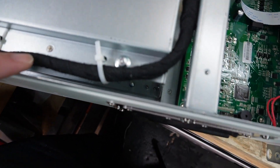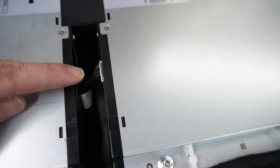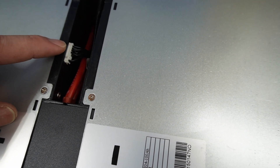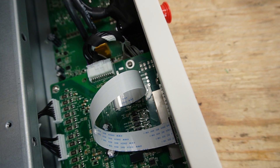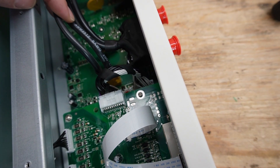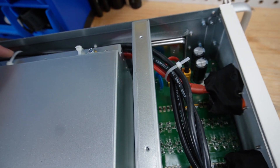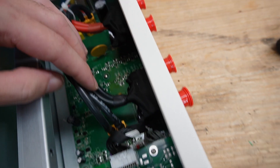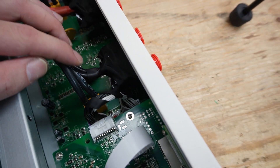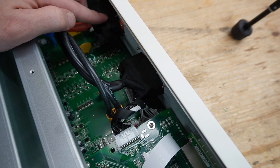The balance cables run down in fire retardant tape, all zip tied, with one balance lead going into each battery pack. Back at the BMS, the negative cables are eight gauge silicone wire — a pair of them — running down to the battery packs. The positive wire is also eight gauge, entering the BMS and exiting to the bus bars on the back, all neatly wrapped in fire retardant tape.